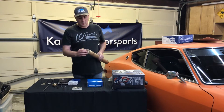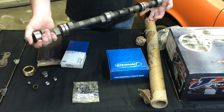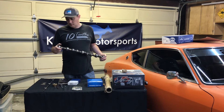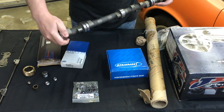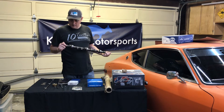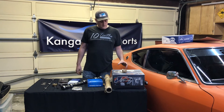The last piece of the Rubello kit is the camshaft that we had reground. This camshaft was ground for street use and light track use — so it's not a race camshaft, but it does have improved performance. The lobes have been modified to match what we were looking for; I think Rubello calls this a 63DI. We'll go through and check each of the wipe patterns to make sure the geometry is right once it's installed. Rubello did go through and set up one of the wipe patterns for us just to get the initial numbers on the lash pads and make sure we're in the ballpark from a sizing perspective.